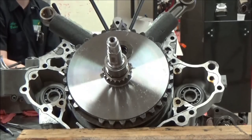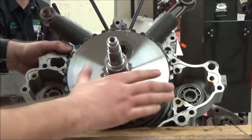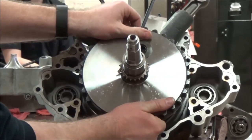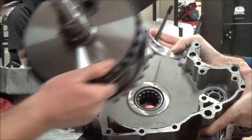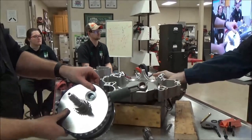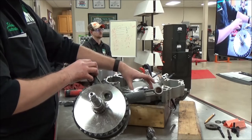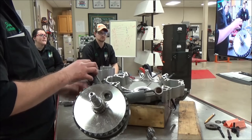I'm going to switch over here. I'm going to lift this up and show you on this one — on this one we're able to simply pull the flywheel out. Remember, on some Harleys you have to actually press the crankshaft out. If you watch our Evo videos on the Evolution Motor series, you can see where we take the press and press it out — and that's what we do.